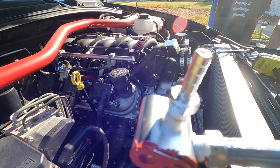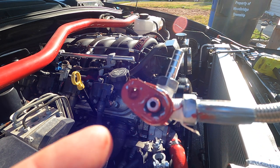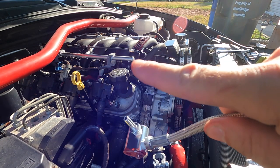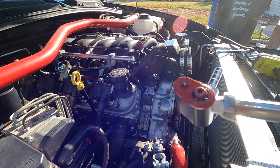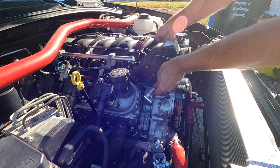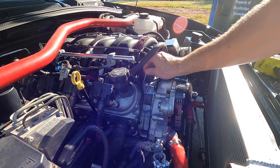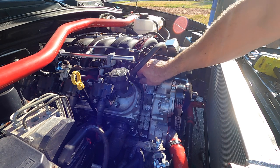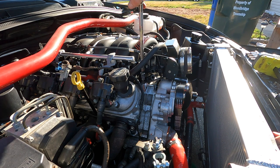I went overboard — I put that little steam port gasket on, first putting RTV, then the gasket, and then more RTV. On the back side of the engine I have these little ones and they still leak, so I'd rather be safe than sorry. I'm gooping these up. Get this little 5 millimeter bolt started back up and get that snug.